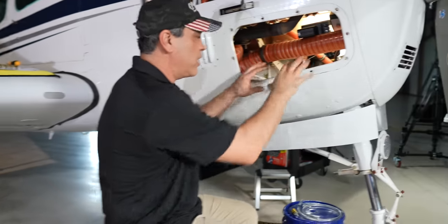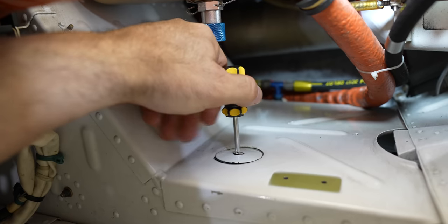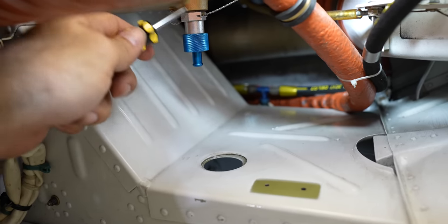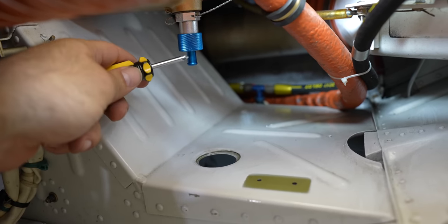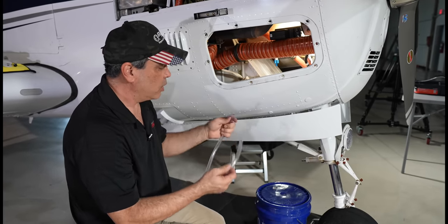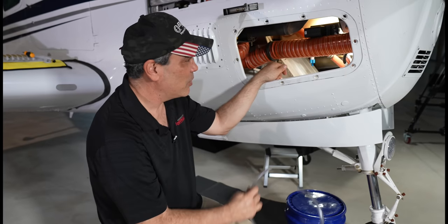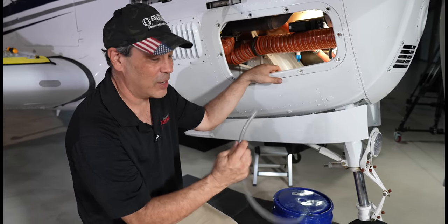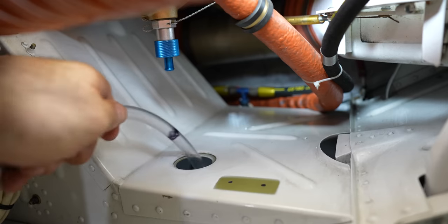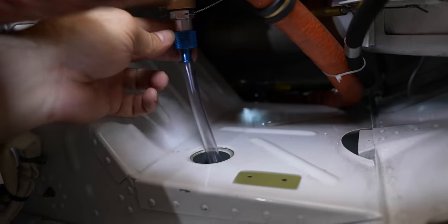Now we have access to the inside. The first thing I do is take the access panel out. You can see that blue fitting in there — that's our quick-drain fitting that's already into the oil pan, and it's got safety wire on it. This is where the hose is going to come up through and attach. I need to use two hands when I put the hose on, because when I push it on it pushes up, and I've had oil start coming out before it was fully seated. So I feed the hose down through the hole while holding the fitting, then push on — boom, it's on.